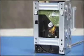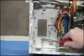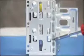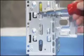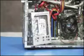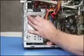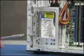The hard drive cage has three tabs at the back that fit into three slots on the wall of the PC. The cage also has four tabs on its side that fit into four slots on the front of the PC. To replace the hard drive cage, align the tabs on the back and side of the cage with the slots on the PC and slide the cage down until it snaps into place. Reattach the two drive cage screws to secure the cage to the PC.